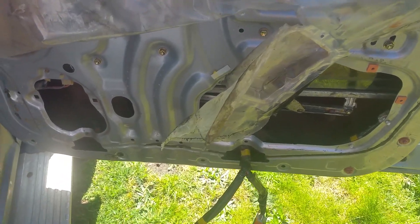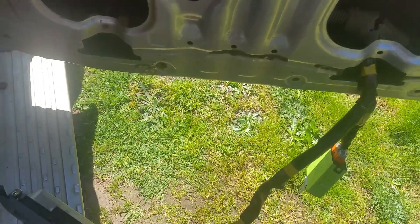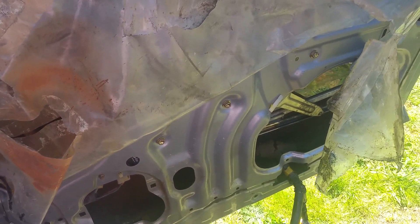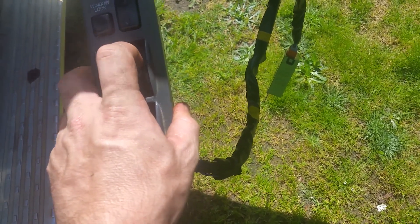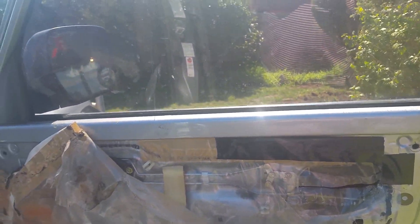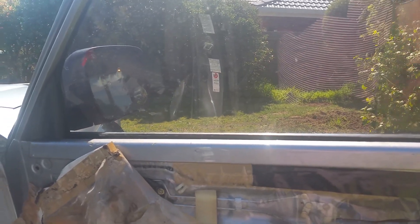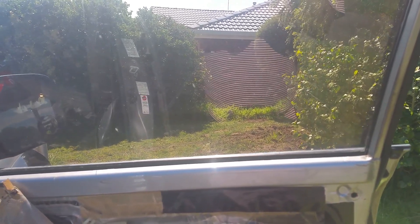Make sure you've got it in the Bailey channel — otherwise if you go to raise the window you're going to break it. Don't do them up too tight, just until you can't move them much further. You can actually test that the window's working properly — there we go, that's marginally better but it is now going up, whereas it wasn't before. So at least now it works properly. That's how to reattach the bottom mounting rail to an 80 Series driver's window and improve its up and down movement. Thank you very much for watching — please like, comment, and subscribe. Cheers!